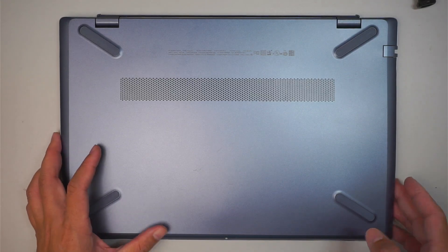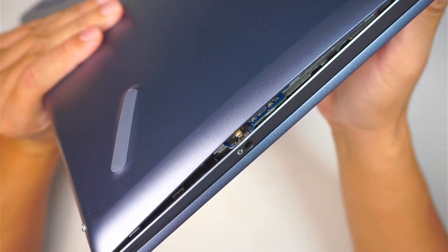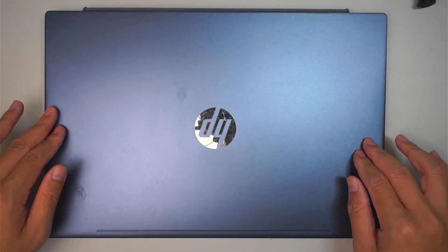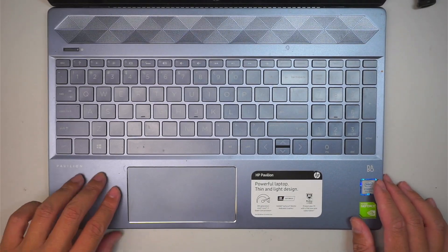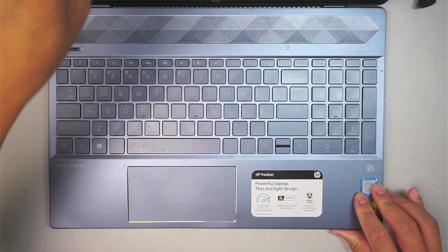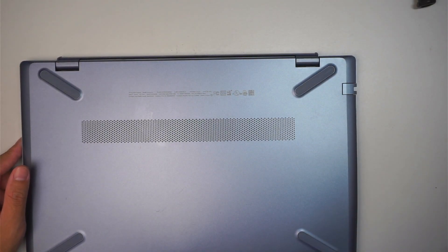Hi, welcome, Simon here. Hope you're doing well. In this video, I'll be replacing a battery on an HP laptop. As you can see, the cover is starting to separate apart and the laptop is not sitting flush, meaning that it wobbles. And you can definitely notice that the trackpad is not clickable and there's a huge lump on the battery — that is what is causing the computer to have a problem. Let's go ahead and start repairing and replacing the battery.